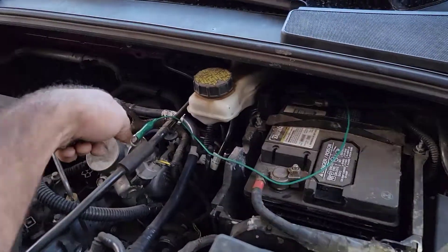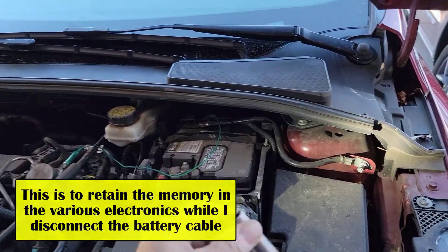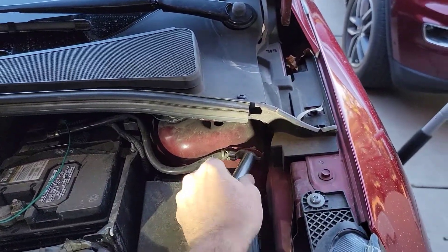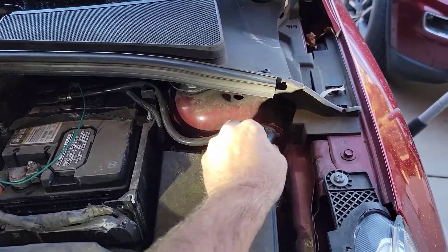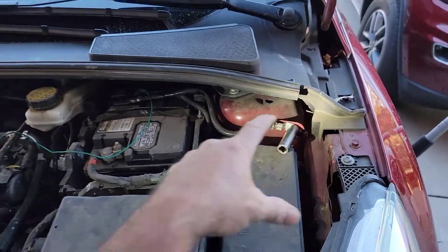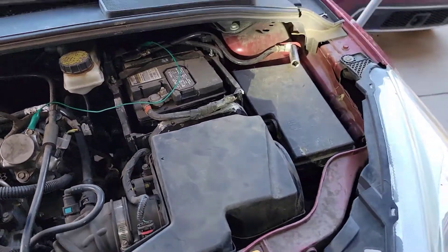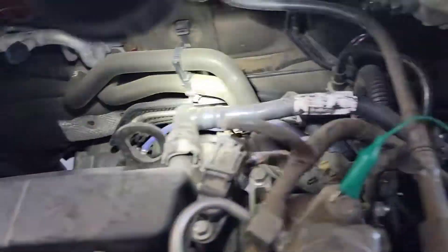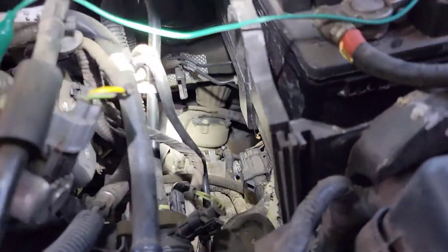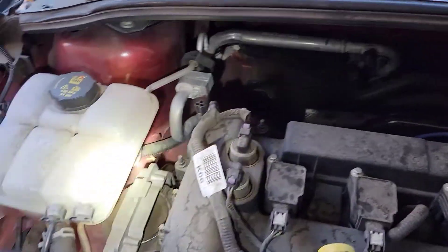So I just hooked up a little jumper over here from the negative to here, just so the electronics don't lose their power when I do this. I'm going to take this off and take a look. But what people said they're doing is just cleaning the paint off and pulling it back on. And I might add another ground strap maybe from there down to the transmission, just for the hell of it too — just in case one of those body ground straps is shite. I don't know where it is; I didn't even look up to see where it was.